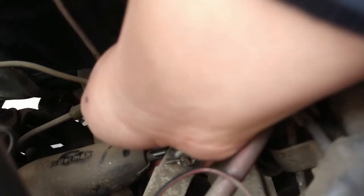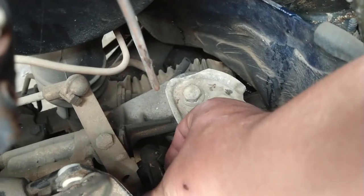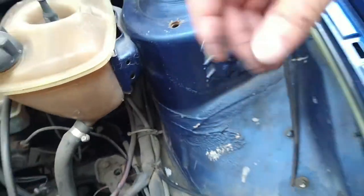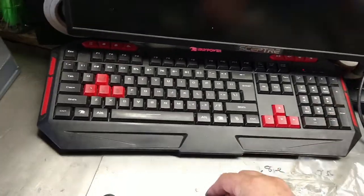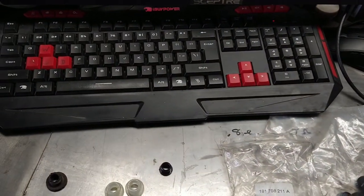There's one that's missing down here. That's the one I'm talking about that I need to get in there. Here, it's right here. This is where it doesn't have that little plastic. So this thing is not optimal, let's just say. See? It needs to have a bushing in there. And that is for selecting the gear. So I might get to it. Maybe. I'm not really having any problems selecting gears, but it is nicer if the slop is gone. And that would be this one that goes there. It takes the slack because it's completely gone. I'll do that some other time.